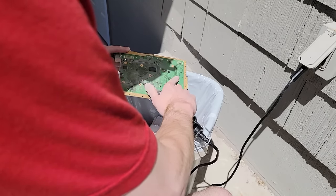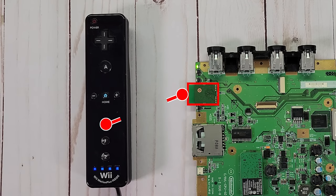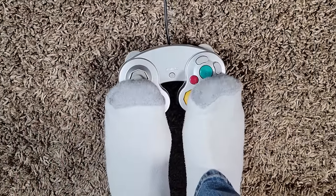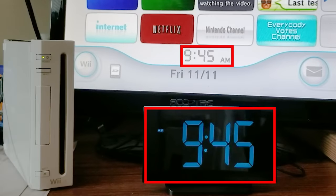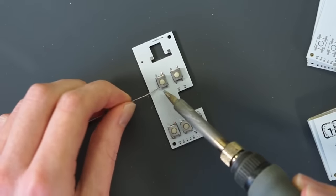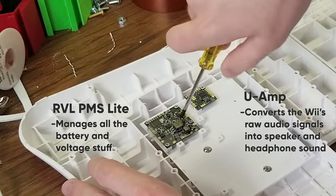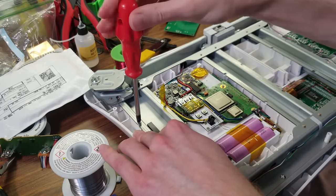Trimming a Wii was a lot more comfortable for me than drilling holes into plastic, and initial tests on this trim are looking good. There are two relocations that this trim needs in order to work properly. The first one is the Bluetooth module, as this is what allows the Wii to talk to wireless devices like Wii remotes and the Wii Fit board. The second relocation that's important for this build is a component called the MX chip, which keeps track of the Wii's clock even when the system isn't powered on. This is critical for my project, as I need the Wii Fit calendar to stay correct for the years of use I'm definitely going to put into this thing. My PCBWay circuit boards have arrived, so I've superglued a 3D-printed battery holder to the bottom of the board, installed the 4-layer tech suite to handle all of the power management and audio, made sure the charging setup works, and modified the Wii Fit power button and LED to make it work for the Wii too.